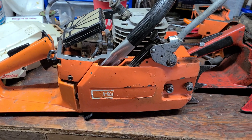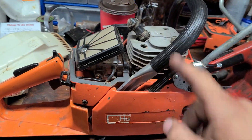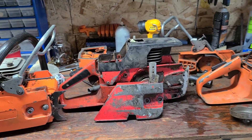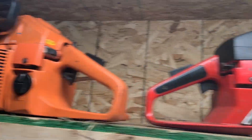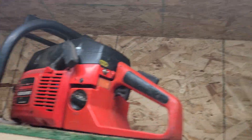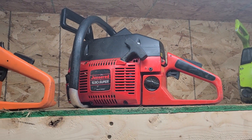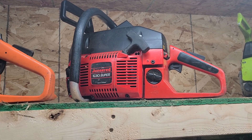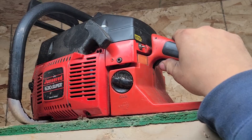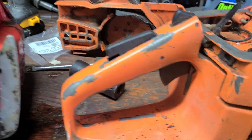The intakes are different on the 272 and 268. The 162, 630, 266, and 61 all have the same intake. The 630 Super has a bigger carb than an early 266 — it has a 254 Tillotson, which is just slightly smaller than the 272's carb. That's why those run so well. The handles on the 272, 266 XC, 630 Super, regular 630, and 162 are all the same — and this one's metal.